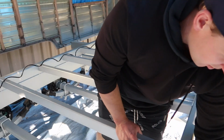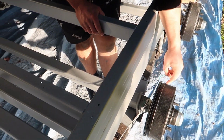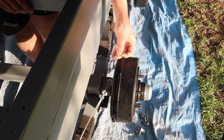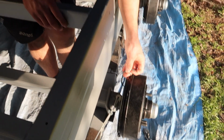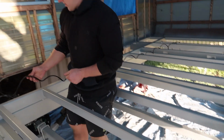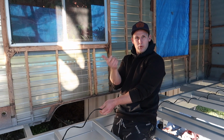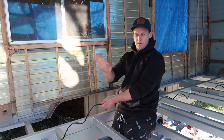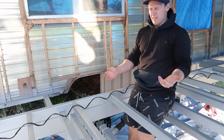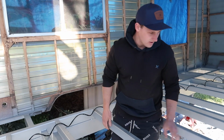And there's no polarity. It's not like a negative or positive. It's just a power and an earth. So it doesn't matter which one the blue and white goes to. And the cable I actually bought was black and red anyway. But as long as I've tapped into the blue and white in this, because that's what goes into the car, the 7-pin, the blue is number 5. It's always going to be your brake, so when you hit your brake, it works. I think 7's the right indicator and 6 is the left, something like that. So you've got to get into the right colour.